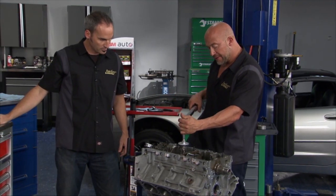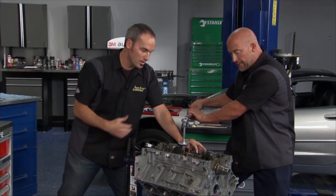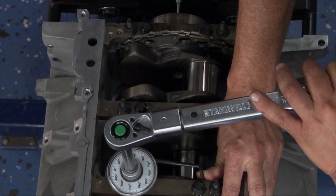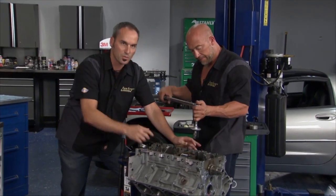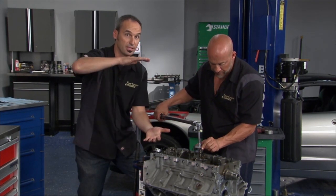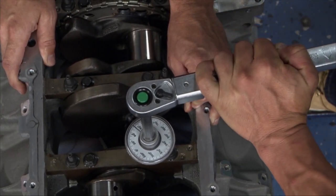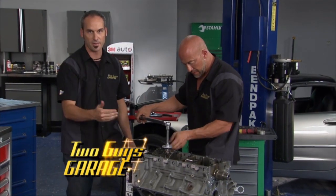It says from 15 pounds, work down to 80 degrees. Why angle torque instead of just a torque spec? If you give a torque spec, depending on what lube you use — moly lube, oil on threads, friction underneath the head — all that friction difference ends up in the torque reading and you could vary quite a bit on actual clamp load. With a light torque you get everything seated, then from there you do an angle, and that angle is more accurate for achieving the correct clamp load. We can now work our way around, then go to the outers and the sides — this bottom end is coming together nice.